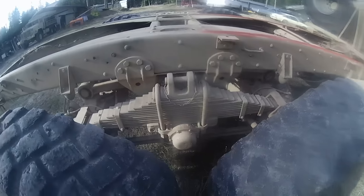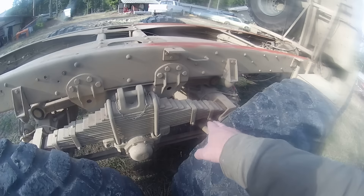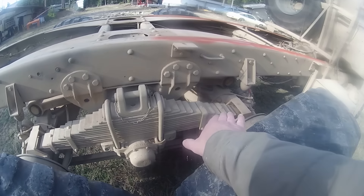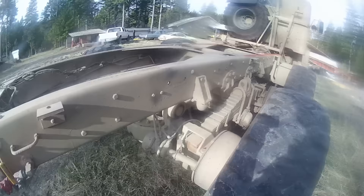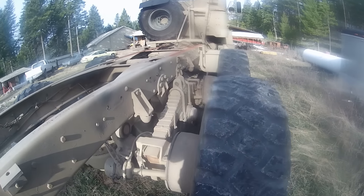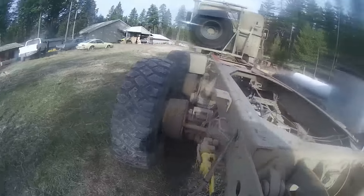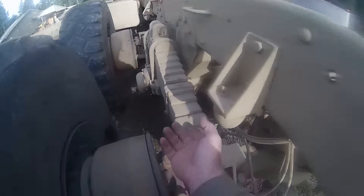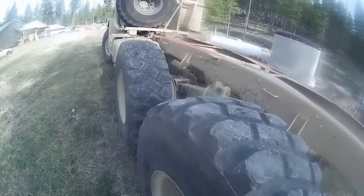Other things came to light once I had the second truck to compare to. Once we had the bed off, we could see that these springs are bent — there's like a reverse arch, and some of the leaves are actually bowing almost upward in many ways. You can see the gap right there — this part of the pack has been bent up.